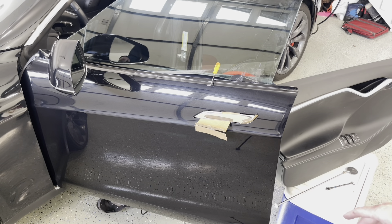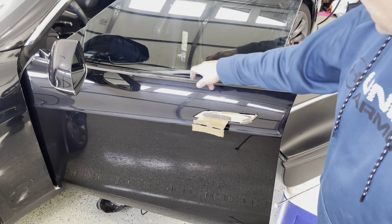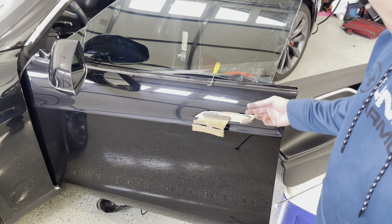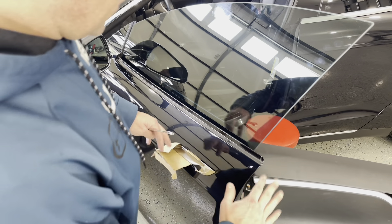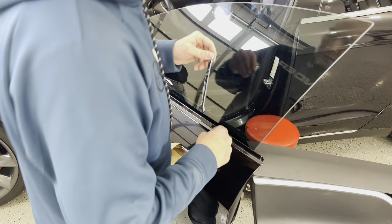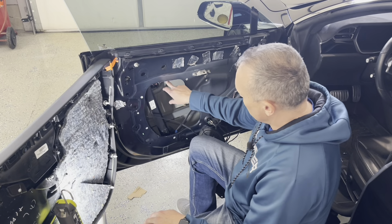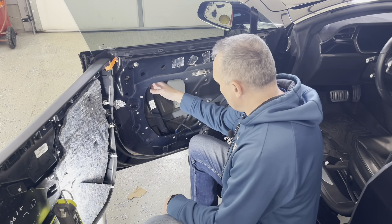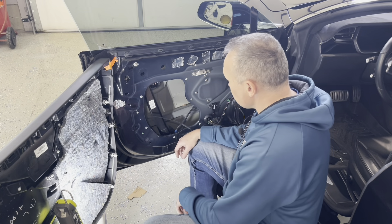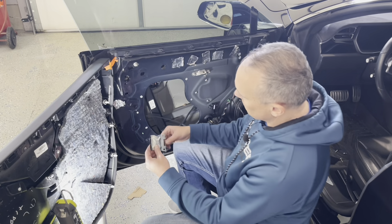So here's what I'm doing: I have the four bolts loosely on there and I'm putting cardboard around the trim of the door handle so that when I tighten it down, it stays centered inside the opening. I have this little pick tool with the window lifted up through there so I don't need anyone holding it while I secure that top nut. I was able to reach up underneath and get the nut started, then tighten it with the open-ended wrench. Got the four bolts secured. This one you have to get to with the open-ended wrench; the other three you can get with a socket.